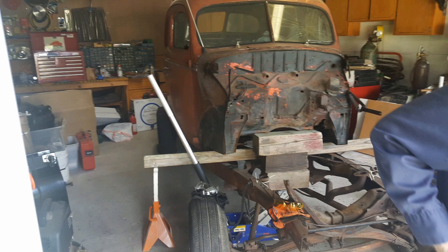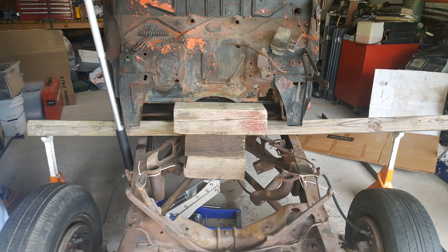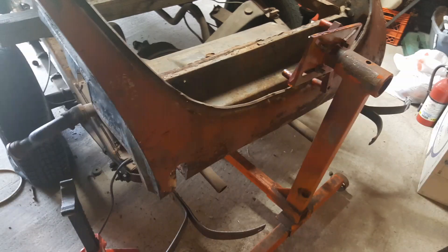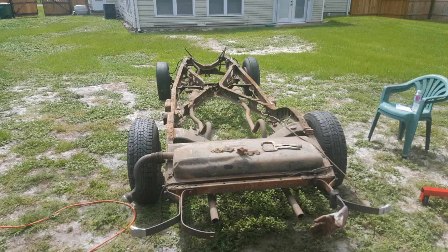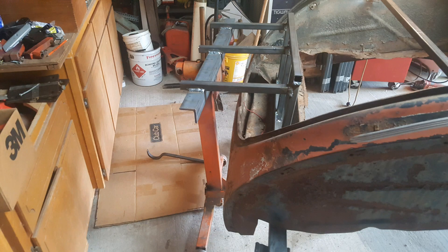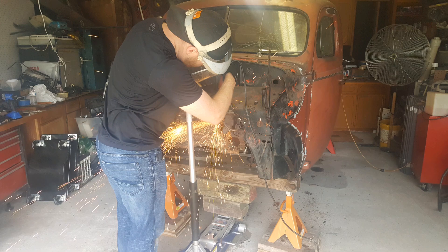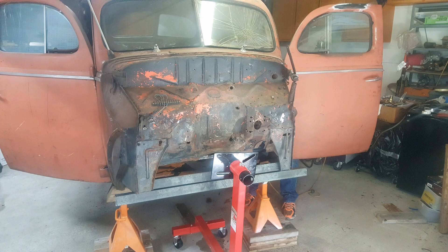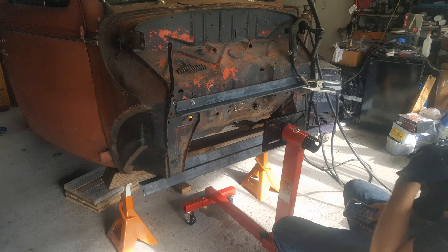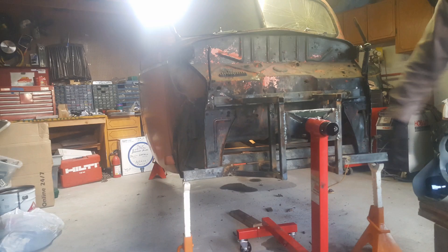After the car was all structurally braced, we attached the rear end of the car to the rotisserie by fabricating — coming up in the next clip — then we jacked up the front of the car and rolled the chassis out from underneath. It was supported on the rear bracing, which turned out really well. We used angle iron to clamp it from the top and the bottom, so it's not just welded. Everywhere we put the angle iron we braced it with a piece on both sides, then welded and attached to that. After shooting this we added long braces down below so it doesn't tip over when you rotate it.